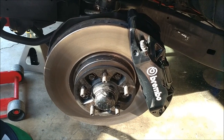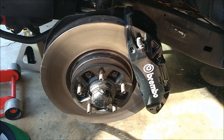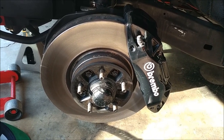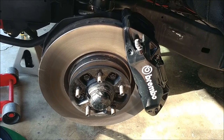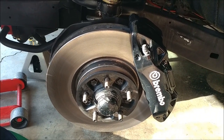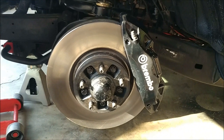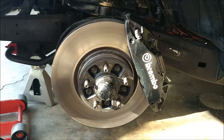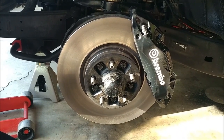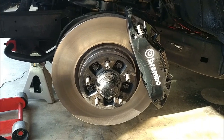But the spindle does need to be drilled out to accept the larger bolts that the calipers use — I believe it's a 14 by 1.5 by 1.5 inch long bolt. It is also shimmed in a little bit — I'll put that in the description. The holes line up perfectly, which was really crazy. I sent them out to my buddy Burke out in New Jersey to his shop, and he called me and told me these bolted right up. All he had to do was drill out the spindle. I did not expect that, so that actually brought the cost down a little bit.